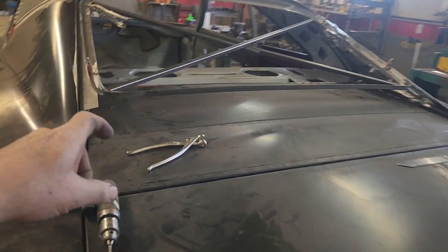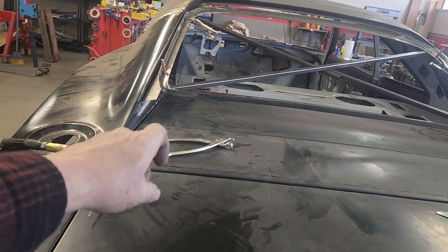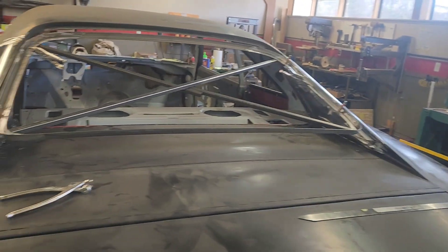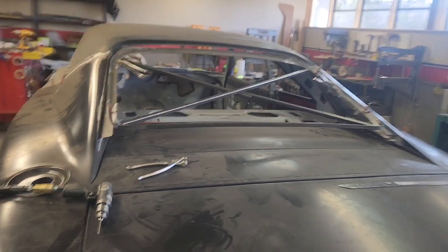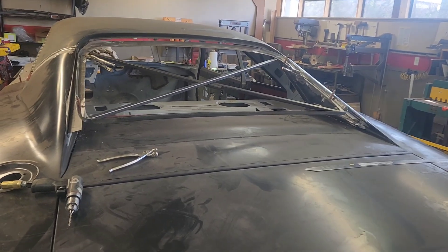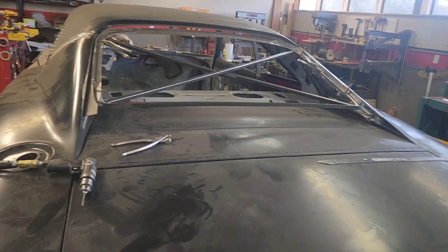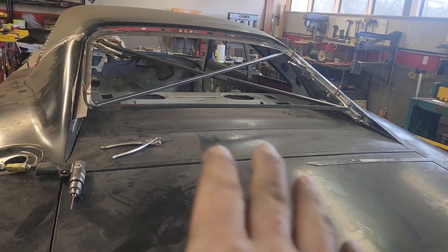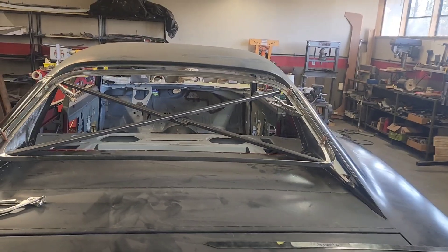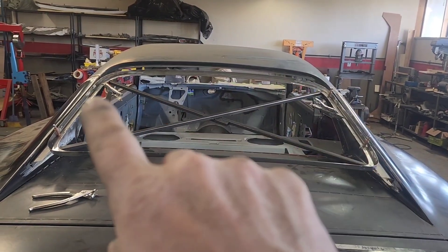The flange also gave me the ability to center this all in the hole - three and three-quarters inches down from the top of the roof at the existing edge, and about 12 and a quarter inches to the leading edge of the deck lid. There's a little fudge factor here and there since these quarter panels are a little bit different on either side. The most important part is that the arc of the rear of the roof matches up, and it does.